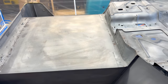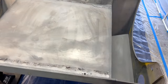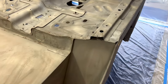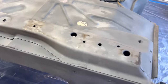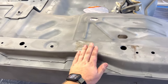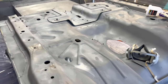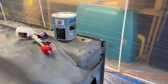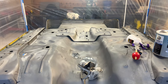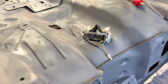My floor had a couple rust spots in it. Instead of paying somebody to fix the rust repair, all I did was replace the floor pan. It's 16 gauge, about 3x3, and it kind of just goes right in where the factory spot welds are. Another thing I did — the body mounts. These are just a body mount replacement I got off of Quadratec. Drill out the spot welds and spot weld it right back in, nothing to it. These were all rusted out — the body mounts were actually caved in with rust and corroded out. Those got replaced. Other than that, I just did a couple little patches here and there. Everything came out really good. I think it's going to be a solid body.